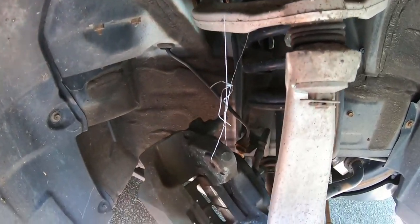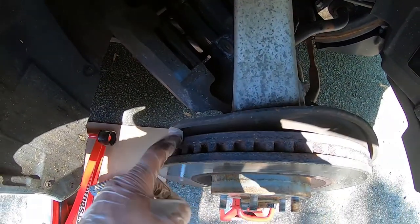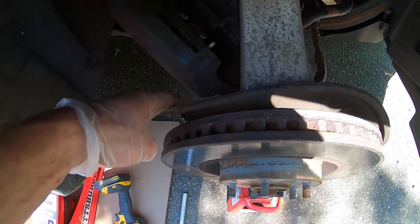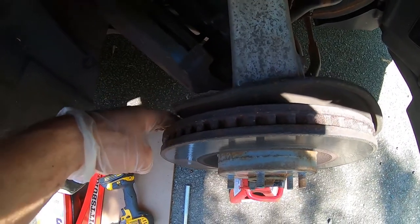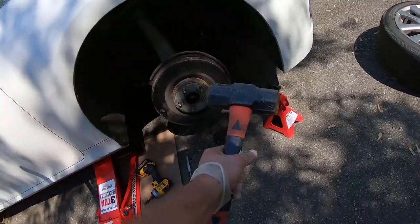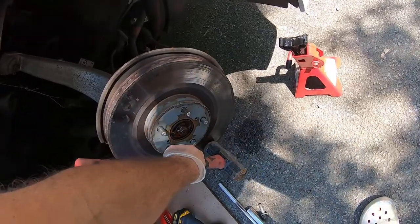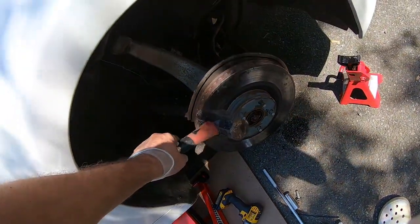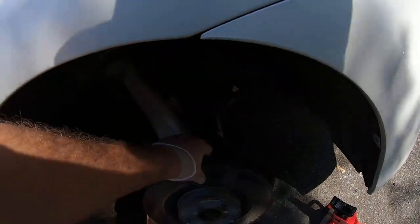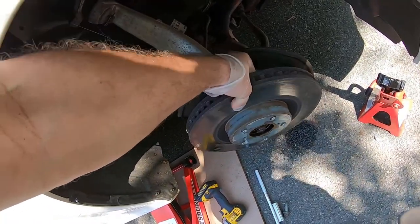This is the view from the top of the wheel well. Now I have the rotor and I've got to remove it. As far as I know it's not held by any bolts, so all I have to do is bang it from this side to hopefully dislodge it — it should just fall off. I managed to dislodge the rotor by taking a hammer and banging it around the perimeter. By banging the perimeter you're sending vibrations and detaching all the grime that's built up, then simply slide it off.